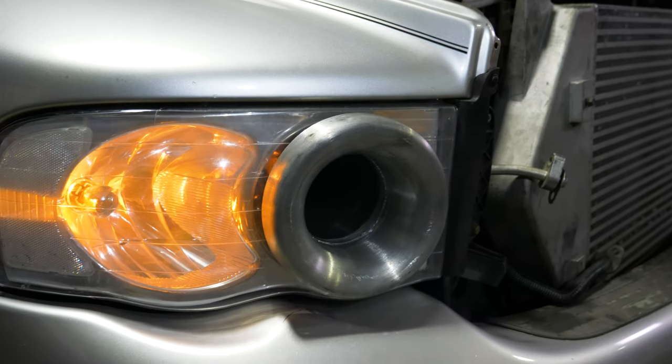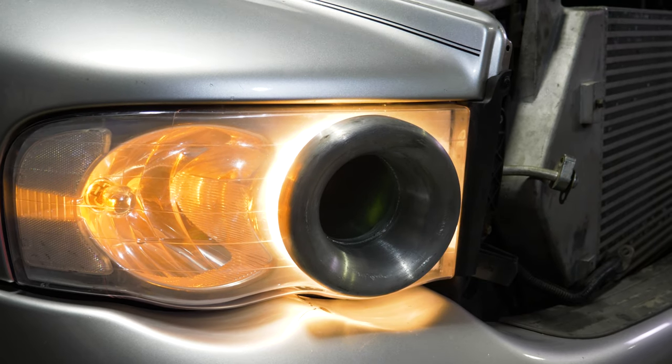So it is a pretty impressive comparison to know that if you get the air, instead of pulling the air right from the turbo down beside the engine in the third gen location, we have a 3 foot tube going up through the headlight, getting nice fresh air through a velocity stack. So you got a good clean intake and the headlight still works. So when he drives it down to the street to get ice cream, then the cop shouldn't be too mad about it. He just won't see very well after dark on the right side.